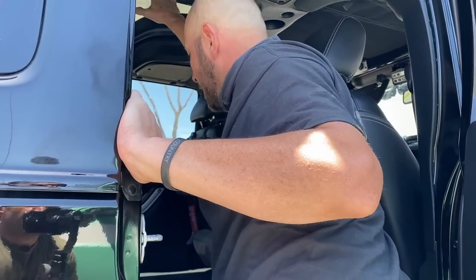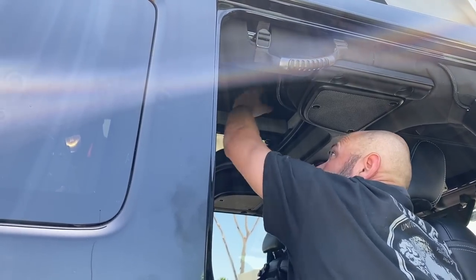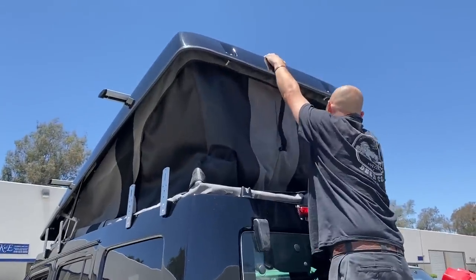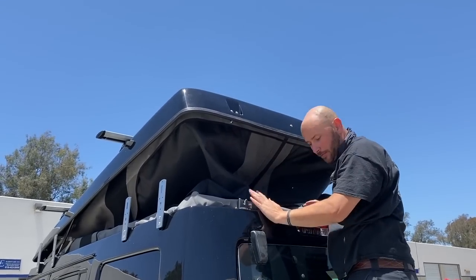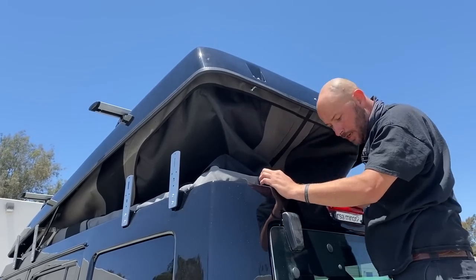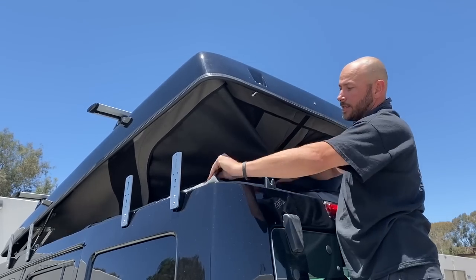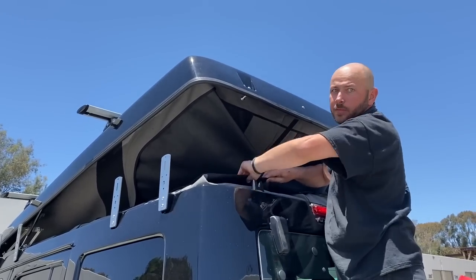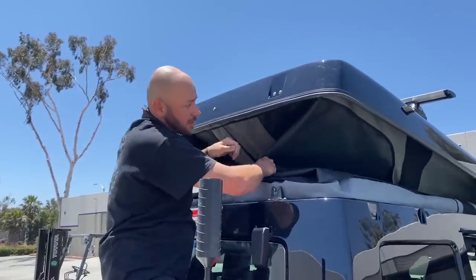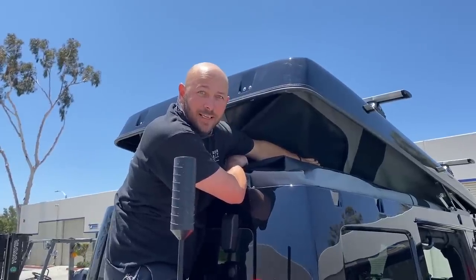When you're going to close it, pick whichever side suits you — put the panel in place and the pad above it. On the other side, take the panel, slide it forward, and the pad goes straight to the back. Grab the strap, bring it down a little. If you've got any weight on it at this point, you'll be supporting it with your arm, because the struts are meant to balance the roof. From here, take your outside arm and pull back, and with your other arm push inward so you get a nice fold. While it's new, try to help crease the material that way — let it learn. Then grab the strap and give it a tug; the tent material swings well inside, about a foot away from the hinge, so it's really hard to damage it unless you're doing it wrong.